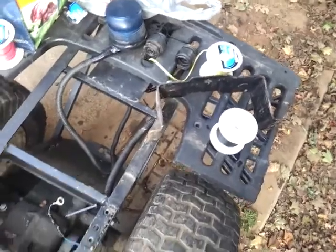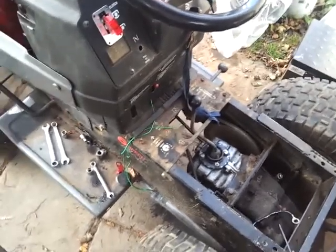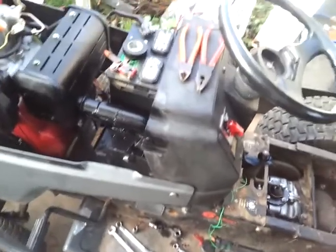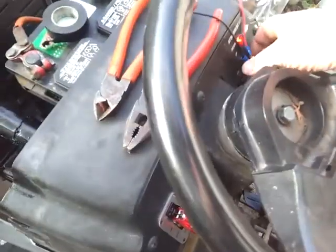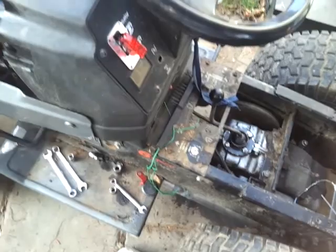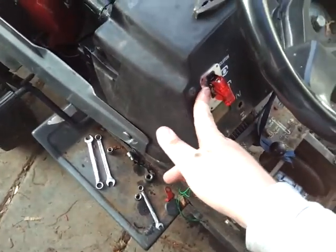I tidied up the wiring in the back - all good and ready to go. That light obviously turns on and off with the key. I'm still having an issue with this ignition; right when I got this tractor it was always loose and I'm still having that problem. Originally I was going to put a redneck ignition in and use that spot to shut it off, but that was with the gas engine - with the diesel I don't need that anymore. I'm thinking of putting this switch where the choke used to be on this side, which keeps the switches separate. This switch is a constant feed - it always has power - and the tail light only comes on when the headlights are on. That saves me drilling a hole in the dash, though I do need to drill four small holes to mount it securely.